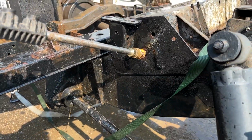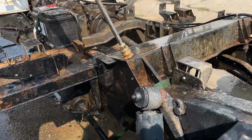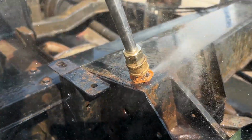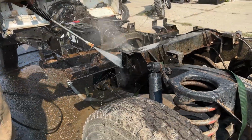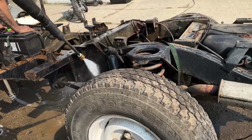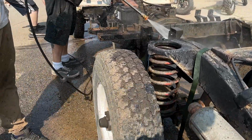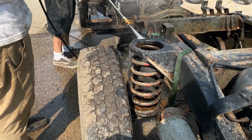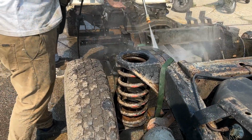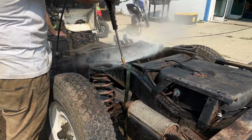It's also a great way to seal it with a wax oil or a cavity wax after you've done this, which seals it on the inside so you don't have any rust issues starting where you can't see it. Getting all that stuff out of there, a pressure washer is great, steam cleaner is even better. Let it dry thoroughly, and then do kind of an inner cavity wax or oil, depending on the climate that you're in, because some of the waxes can harden in cold climates like Minnesota and crack, and defeats the purpose.